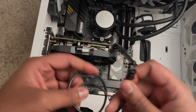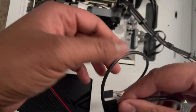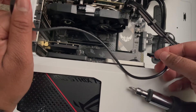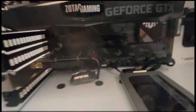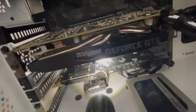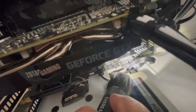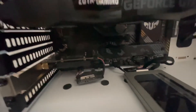You want to come in and take this piece. I got a USB header over here, but the cord management is going to get me. I paused the video to figure out my cord management — I connected it here, ran it down under, brought it back up and connected it to the motherboard. So you're going to need your USB piece to connect it to the motherboard, and then connect your Bluetooth piece to the back of the card. I ran it through the bottom — paused for cord management — and now we're good to go.